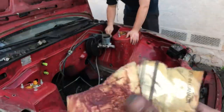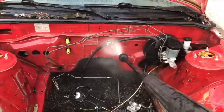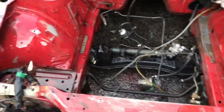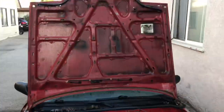We're using some 220 sandpaper to scuff off the engine bay a bit so we get the paint a nice surface to stick on. The engine bay is all sanded and washed, all the dust is off. We've got to mask the brake booster, brake lines, fuel lines, subframe, and harness, and then start spraying.